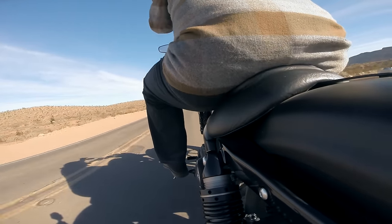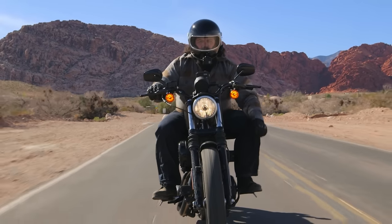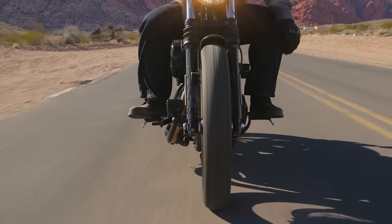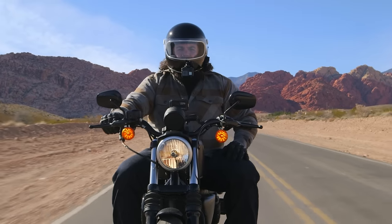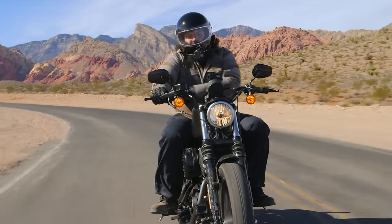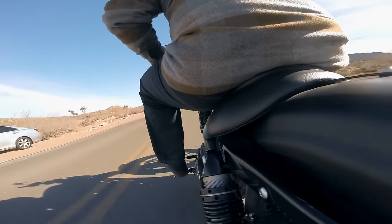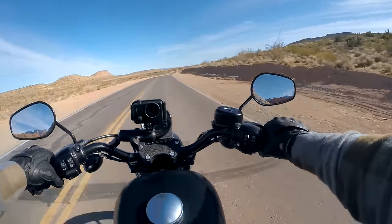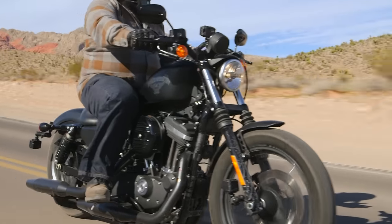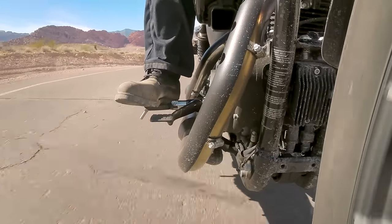Handling is really the next thing on everybody's mind. Sportsters are not all created equal — I think the Iron 883 is the best handling Sportster you can currently buy from Harley because of this front tire. It's 19 inches but nice and skinny, tips into a turn easily, and goes wherever you point the motorcycle. This is a 39-millimeter narrow glide front end; Harley's been using it for a long time and there's plenty of aftermarket support for it. Out back, new for 2016 are preload-adjustable shocks — a big improvement, but still inadequate for two-up work due to limited travel of well under two inches. The Michelin Scorcher tires are fantastic, and with the exception of some poor ground clearance on the Hero Blobs, this is a great handling bike.